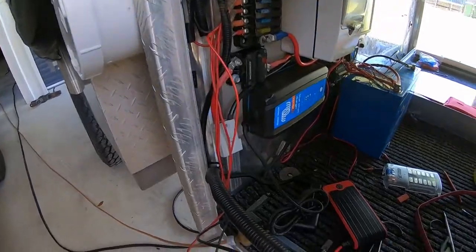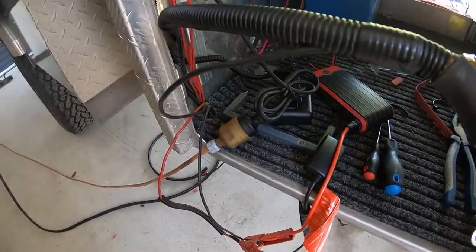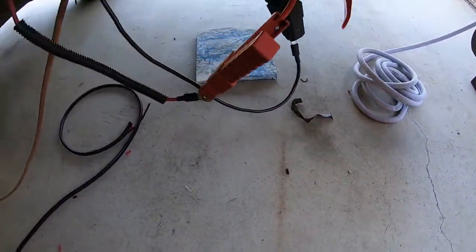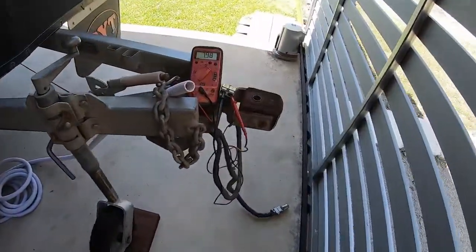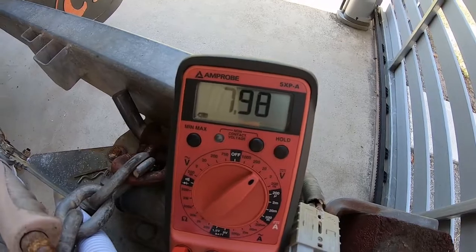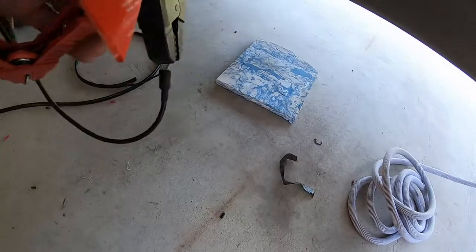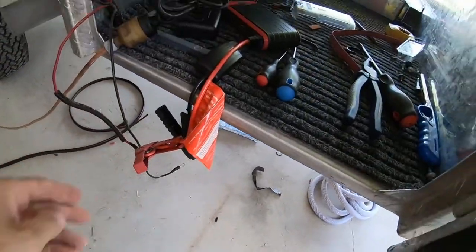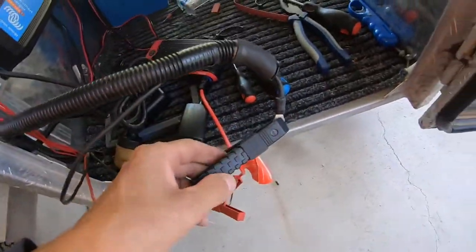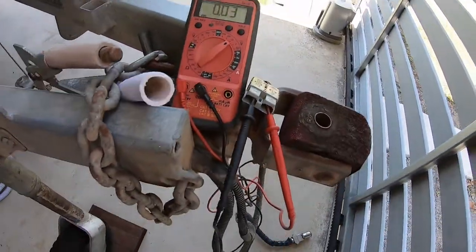Just a little hurdle I've come across — there are a few different bed wires here and I'm not sure which one was for the Anderson plug. I've hooked up a little patch pack with alligator clip terminals, come in and put them on the Anderson plug to get a reading. The patch pack's a bit flat but it gives me a general idea. I tested each wire and confirmed the one I'm after.